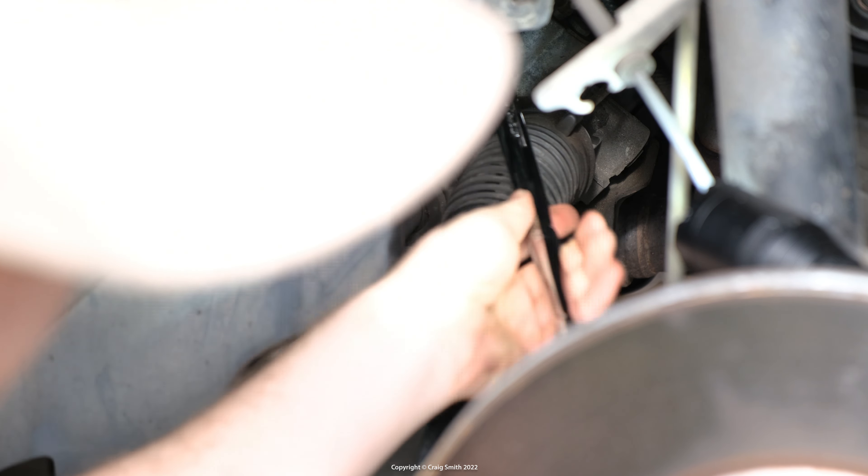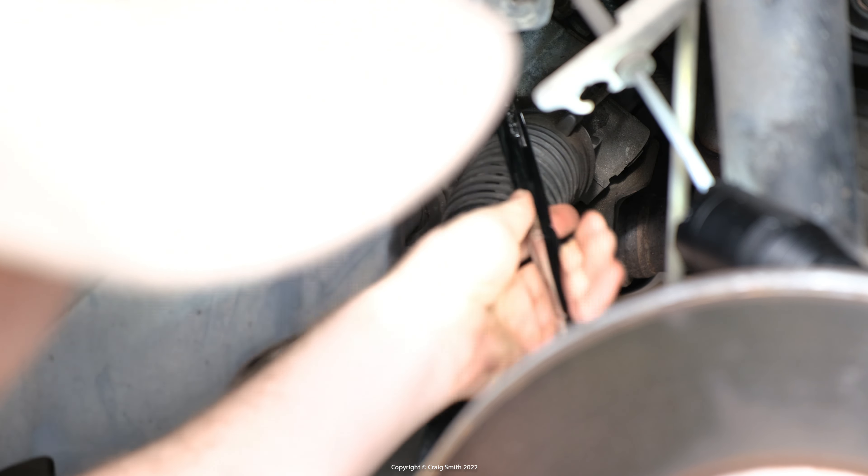There's also a little plastic clip which holds the power steering return line right in the middle of the rack. It has a clip on the rear side which has to be released by prying it open with a blade from the top. Next you'll want to drain the fluid out of the system. On this car there's a dedicated drain hose plumbed into the union at the rack — easy to identify as it's the hose to nowhere, clipped up next to the main hose from the pump. It has a metal plug that's hose-clamped in place; release the clip with a blade and the plug pries out easily. You'll need an oil drain pan here. Once the fluid's drained from the pump and hose, the plug can go back in and vice grips on that clamp will get it secured — and now you'll get less of a mess when you disconnect the lines from the rack.